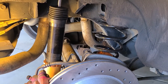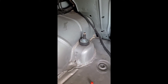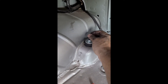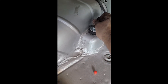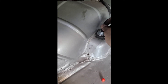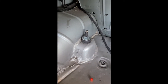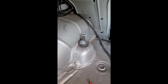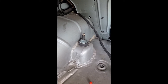It works pretty well. For adjustability, here's how you adjust the rear rebound dampening on the shock. This little knob right here — just twist it. It's righty-tighty, lefty-loosey. Since this is a dedicated race car, I go about two to three detents from full tight. As you rotate the knob you'll feel little detents that tell you where your setting is. That's how you adjust the rear shock rebound dampening.